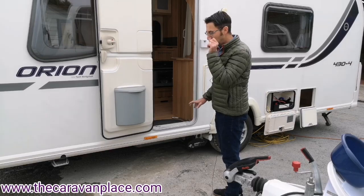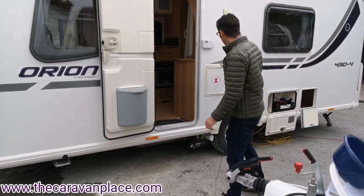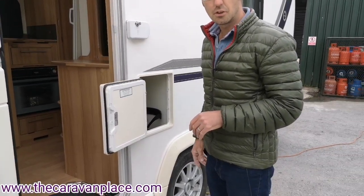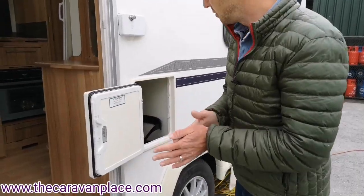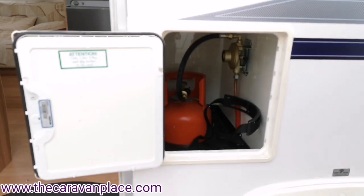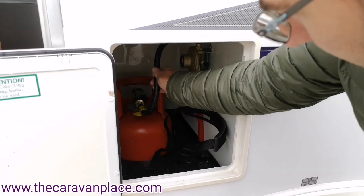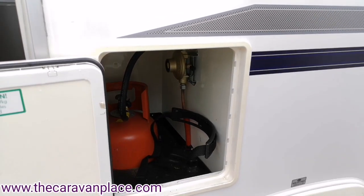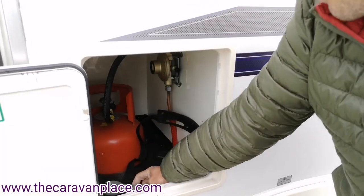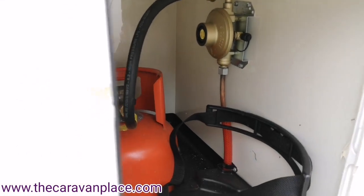We've come to site and we're going to get ready to set the caravan up and run you through how everything works. Starting with the gas — we need to make sure that everything has been turned off inside and is in the off position, so nothing is going to light up. There's room for a six kilogram bottle at the back, and also room for a 3.9 kilogram. We've got it set up on propane, so the pigtail here with the screw connector will be on the van. Remember that it's a reverse thread — to tighten it, you loosen it in a conventional way, and to take it off, you tighten it in standard terms.